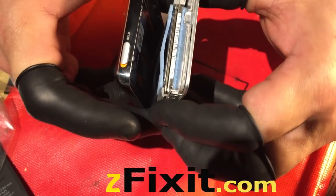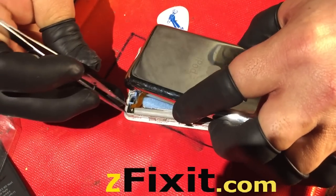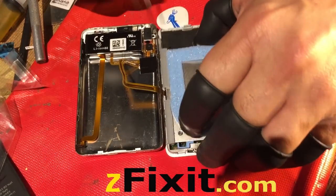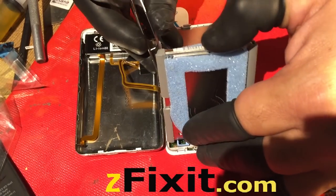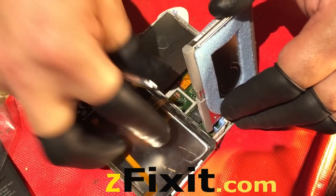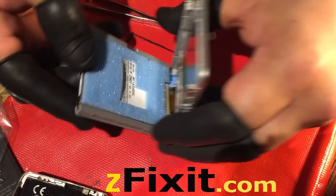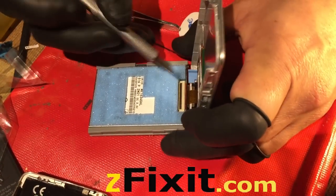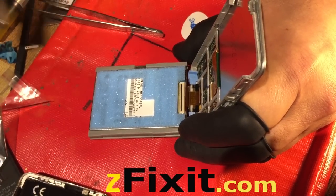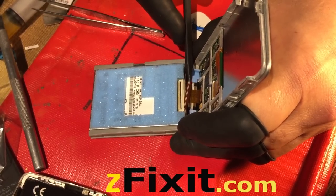There's a certain process to opening this device. You've got to use serrated tweezers — never use smooth tweezers to lift the battery connector, and don't ever pry it up on one corner. It has to be lifted on both ends. Here's the headphone jack and the lock switch being disconnected. You have the hard drive connector, which is just pushed up — it's a locking mechanism. With the flex cable, it needs to be gently pried. Sometimes it's in there very well, and with a plastic spudger you just try to loosen it up.